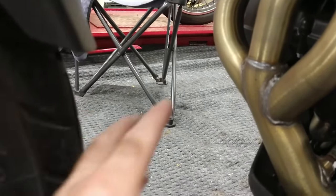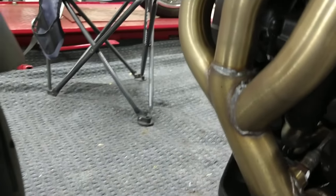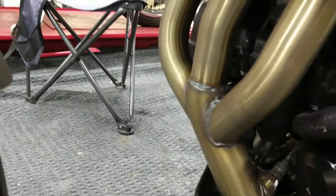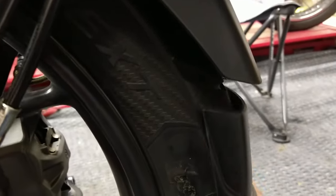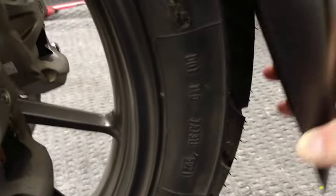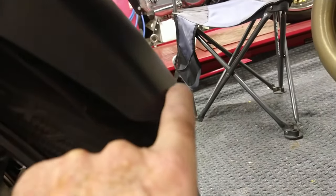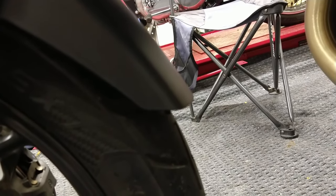Switching to the front fender extender. One of the reasons I want the front fender extender is because this area catches a lot of muck. I noticed on the first bike I had, it caught a lot of muck right there — it's really difficult to clean. So I'm going to add this front fender extender. It fits on here kind of like this. There's the option of putting some pop rivets in there, but in order to do that I'm going to have to drill some holes. I'm not real confident I can drill a hole in here without drilling into the tire, so I think it'd be better to pull the front fender off and drill the holes, then put the rivets in and put it back on.